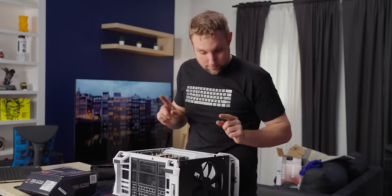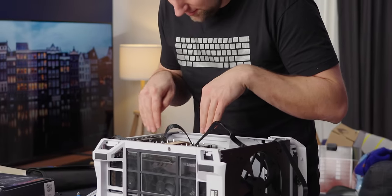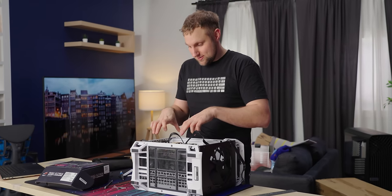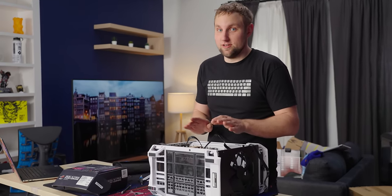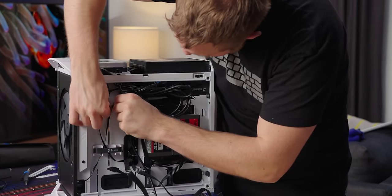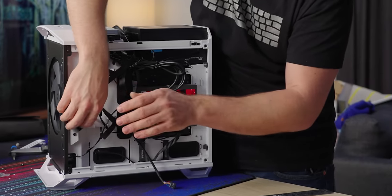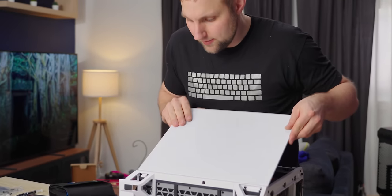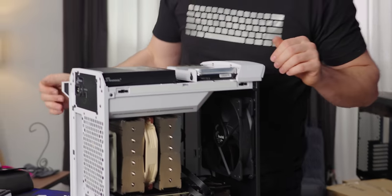GPU in. We need GPU power. All the fan headers are sitting up against the top of the case, right under the power supply. So we had to remove the motherboard again, slide it back, put the fan headers in, and move it up — you're only going to be doing the fans once, so do it ahead of time. Open up these cable management loops. Yeah, this is about the level of cable management I expected — great on Fractal's part, bad on mine. 100% me.